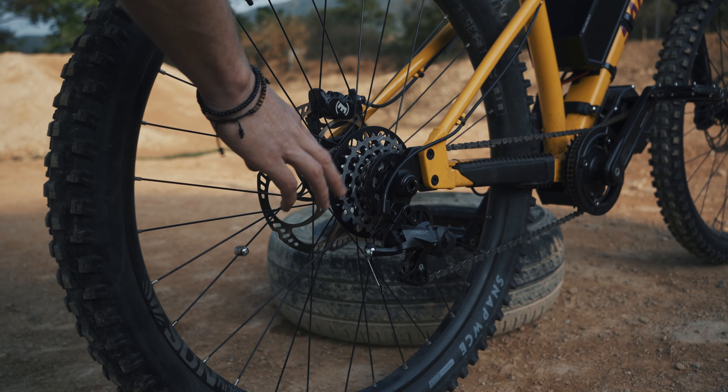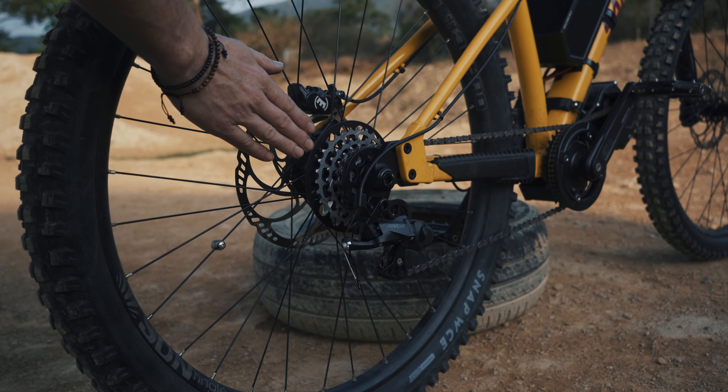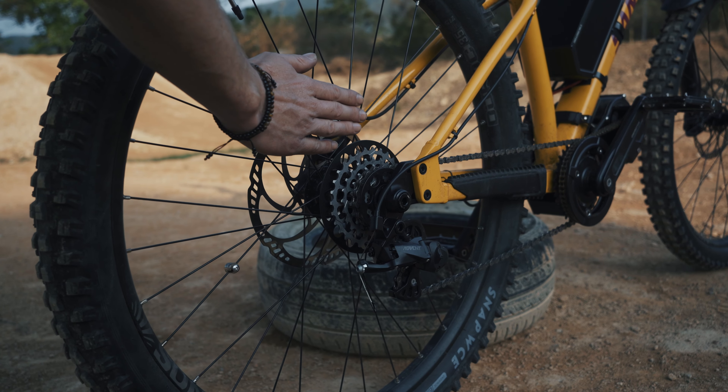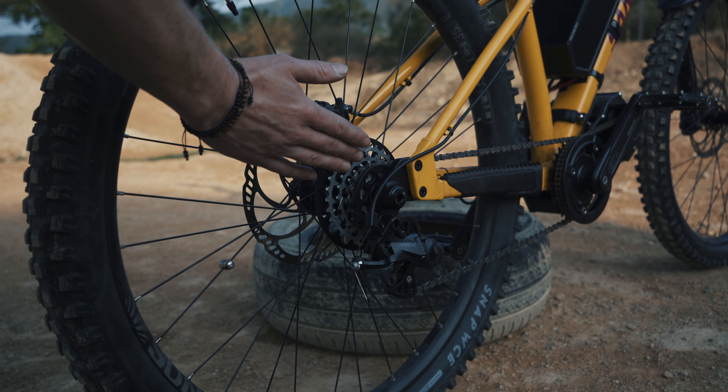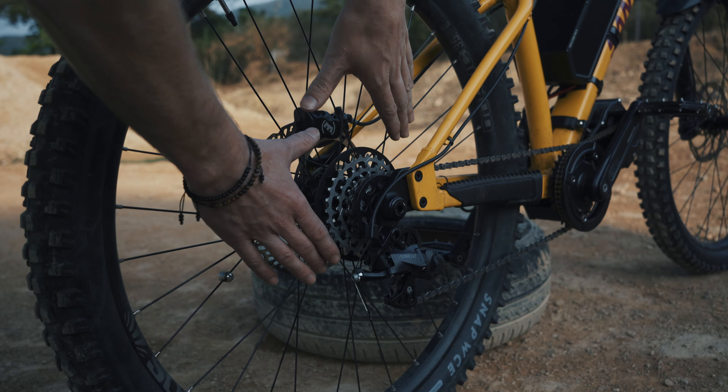The reason for this setup is that with standard cassettes, if you use the full power of the bike in the top two cassettes, because of a bad chain line and the size of the gear itself, in some cases it's possible to fold the largest and second largest cog on a normal mountain bike cassette because it's so large.